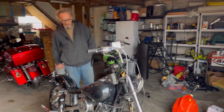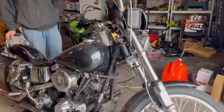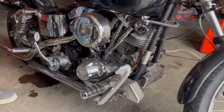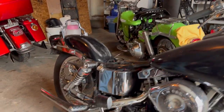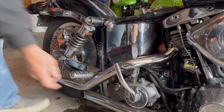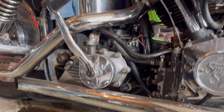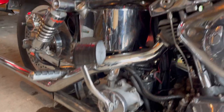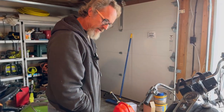Thanks for coming back to Hobson's Choice Harleys. What we got here is a 1980 FX — all kinds of stuff going on. Buddy of mine brought me this bike; he had some work done and the whole thing is seized up on the transmission. I don't know if it's going to be a transmission rebuild — I'm thinking it's just a push rod, the transmission push rod or the linkage. This is a rotary top transmission. He brought this by and said fix it, so that's the plan. Next couple videos you'll probably see me tearing the primary off on this, diagnosing it, and hopefully getting him back up and on the road soon. Stay tuned.